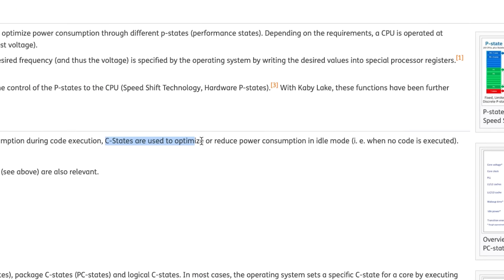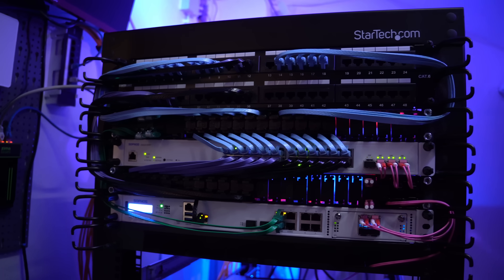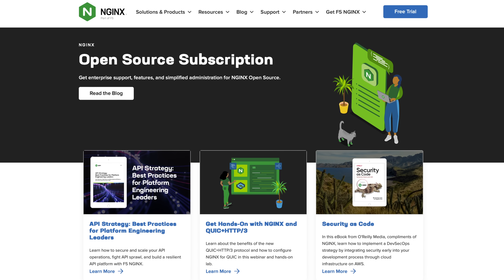But what you need to consider is that these older generations of hardware components were not usually created with power efficiency in mind. A lot of improvements have been made in recent years, especially in CPUs, when you look at C states — the low power modes a CPU can enter. This becomes especially relevant in a home lab because, compared to a gaming PC that utilizes most of the CPU power, a home lab server workload like a web server or data storage means the CPU mostly sits in idle, waiting for requests and then going back to idle.